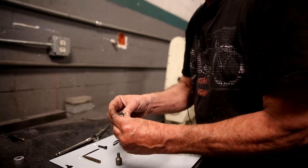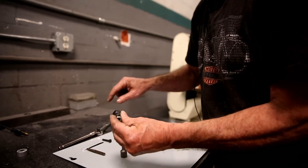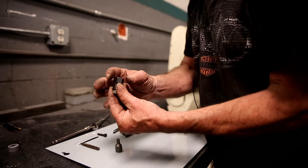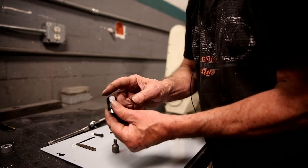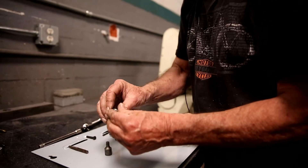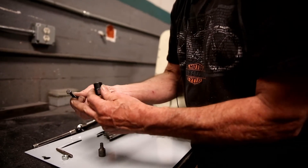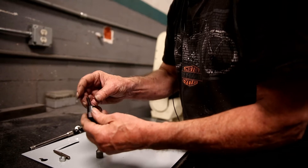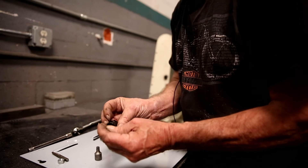You do make some tools that have a complete through hole on it. So you would put this in there, and it has a socket that would go on the outside, and then the ratchet actually has a hole through it so that a stud could be sticking out through the ratchet and you could still get this off. It's all a matter of finding the right tool for the right job. If you have a nut or a bolt with a hex head that's stripped off, you fit that over it — this grips it and extracts it.